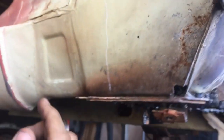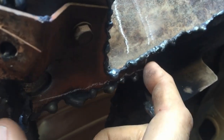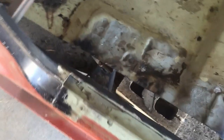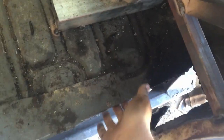Trying to cut smaller and I can go back and clean up the edges — all this I'm going to pry off and then it'll be the factory lip right here. I just gotta cut one more little notch because this right here stops and then goes up, so I need to carry that over about four and a half inches. This should get plenty of room for the frame to sit up in here. I lift up on this and it just tries to lift the whole body — that's what I was worried about.